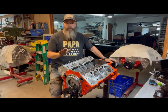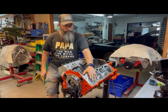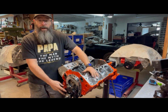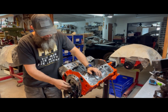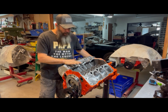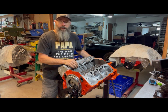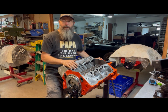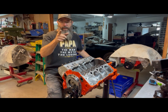That's about all I can do on this build for today. I don't want to roll the engine over anymore to check valve-to-piston clearance by putting the other head on until I get my timing tab locked in. I had to stop on the installation of the balancer because I put the cart before the horse and realized I don't have a cam button and lock plate for the cam — I'll have to get those ordered. In closing, it's nice to be able to spread the knowledge. I may not know all the ways to do it, but this is how I do things. Get some young kids involved, share that knowledge, and just start building. I'll see you next time.